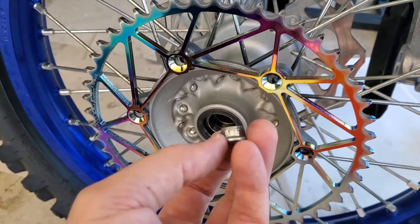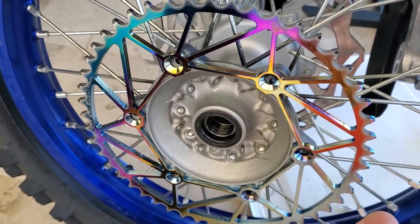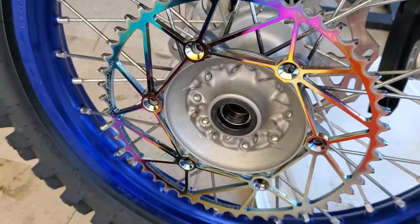So I'm going to say: don't use the washer, make sure your lock nut penetrates all the way through, and use Loctite. The new kit I ordered comes with pre-installed Loctite. I'm going to make sure it penetrates all the way through, torque these to the correct spec — not over-tighten them — and then check them regularly, because I should have checked this sooner.